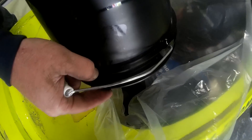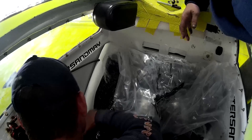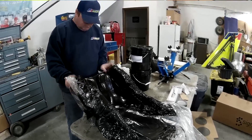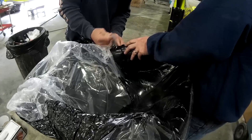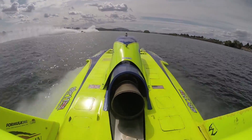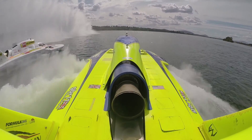The seat is made using a two-part epoxy in a unique design. You place a plastic bag in the bottom where you're going to sit, I'm seated in the boat, and then we mix the two-part epoxy and pour it into the bag. It creates a foam area that surrounds my body and makes everything fit right to my form. The Peters and May race team continues to get ready for the 2016 unlimited hydroplane race season — watch for the next episode.